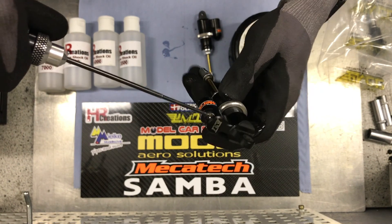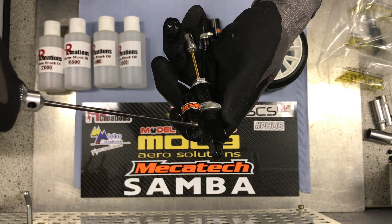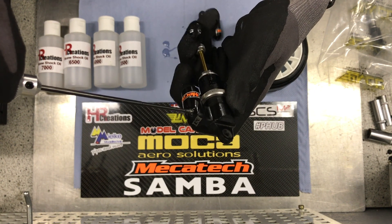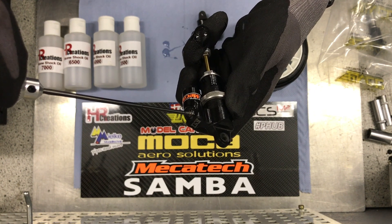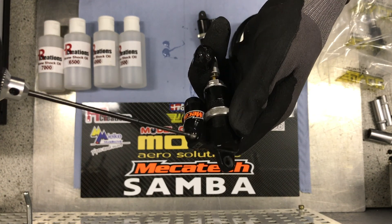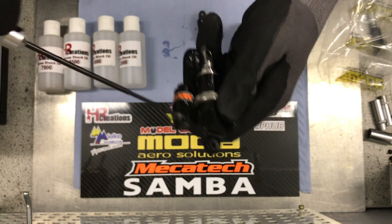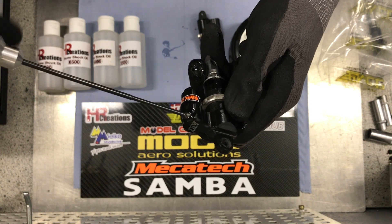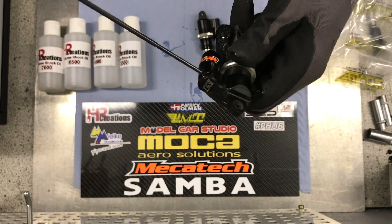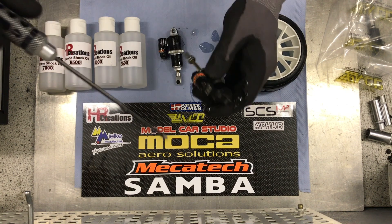So, with the screw out it's very free, but I will just keep it nearby to make sure I can close it very quickly again. I move up the piston, let out a small amount of oil, and there it goes. Just turning the screw a bit to make sure all oil is out, and tighten. Boom, boom. Now the shock is actually finished. We'll do the same with the other one.